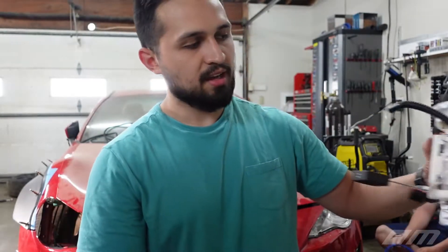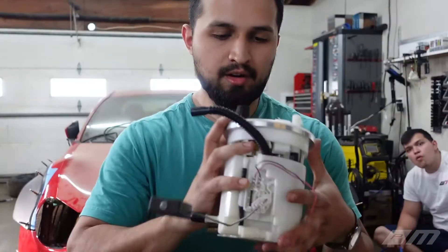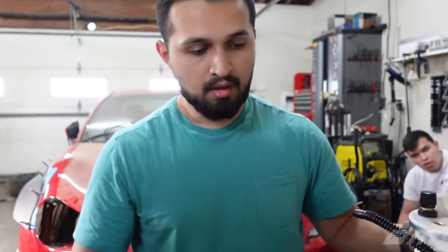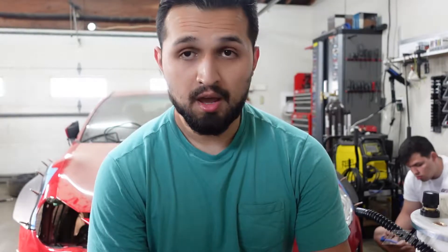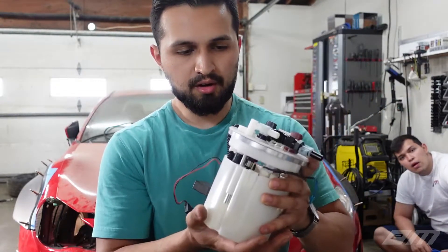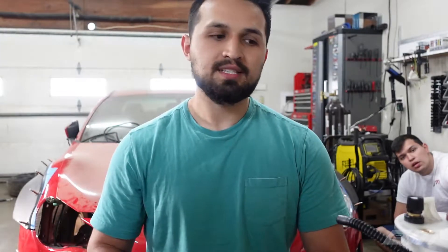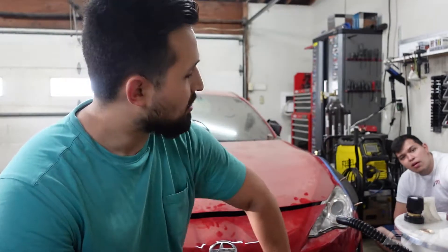Today we're going to do a recap on the fuel pump. It was not kicking on, but now I know the reason. Since it's out, I've decided to go over the entire system — how I got it to fit in the stock fuel carrier assembly. A lot of you have been asking how I did it. It's actually one of our most viewed videos, and it is tricky because you don't have a lot of clearance. The opening for the fuel tank is basically the exact diameter of the carrier.